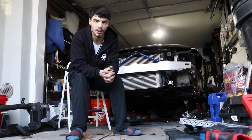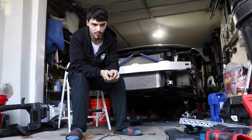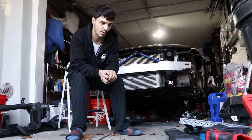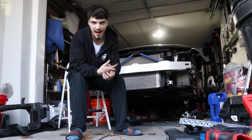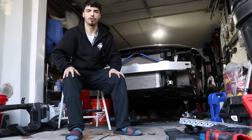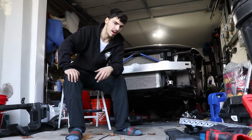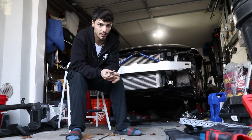Now it's just durability. I mean, we go through our axles pretty regularly now, because if we're running a bigger tire, that's more stress on the rear, and they're already 10.5 in the rear, so it's already increasing the stress. So we're gonna need to get built axles. Drive shaft isn't really choking up, but if you're doing the axles, might as well do the drive shaft as well. Getting some oil in the charge pipe as well.